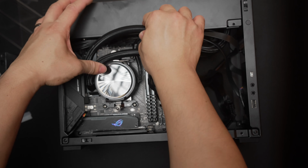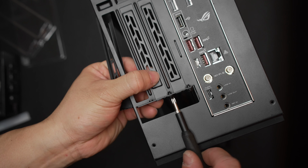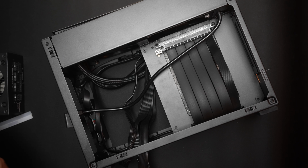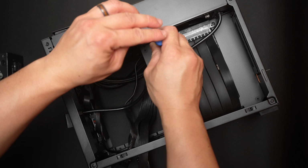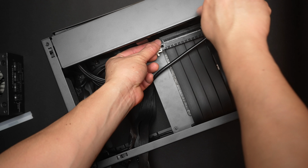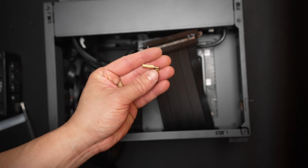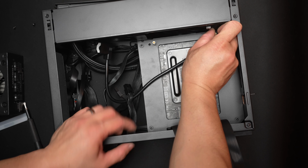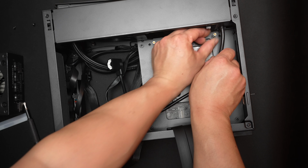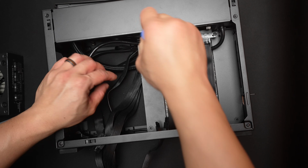Let's go ahead and switch gears now and let's do the other side. The GPU side here, remove 2 slots for our 2-slot card. And you'll note that I'm removing the 2 outer ones, and that's because I'm swapping out the installed standoffs in order to pop in extended ones. My review unit here didn't come with the extended standoffs, but as I understand the retail ones do, so just go ahead and pop those in. Screw them down tight with an adapter and then put that riser cable back on. You're going to want to do this step especially if you have an Ampere Founders Edition card.